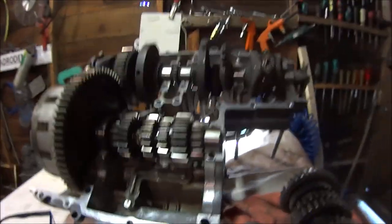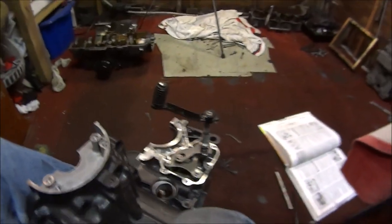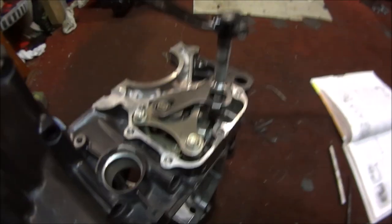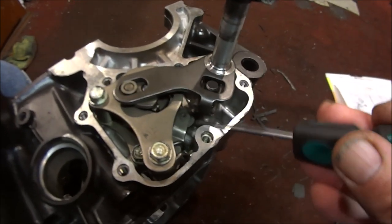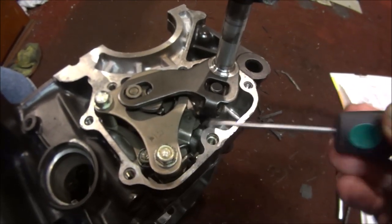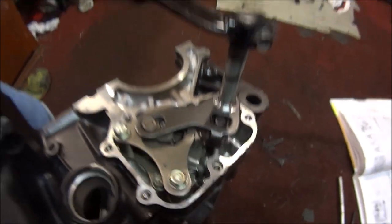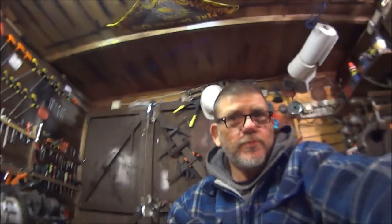Just to let you guys know I'm having a bit of trouble. I've done a dry rebuild so I could check the gears, but the gears wouldn't select at all. I went back on myself and realised that the little wheel thing inside — I put it on facing the wrong way, back to front. So I swapped all that out, put it all back together again, and all the gears work perfect.